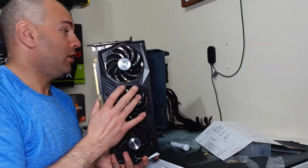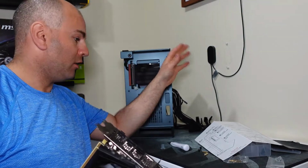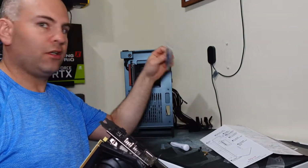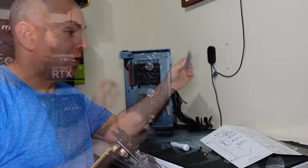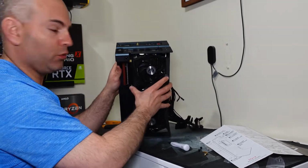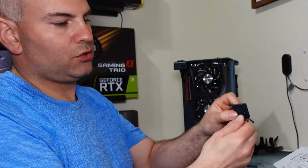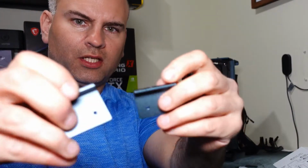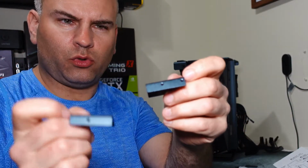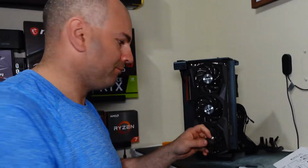So next, you want to put the graphics card into your PCI Express slot. There's little fixture pieces here for your graphics card to actually hold in place tightly. And now the graphics card is not secure whatsoever, and that's what these are for. So both these are the same for the screw holes. It looks like a 1 screw hole card and a 2 screw hole card for extra security.